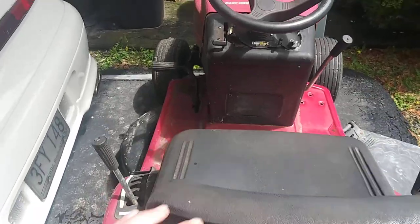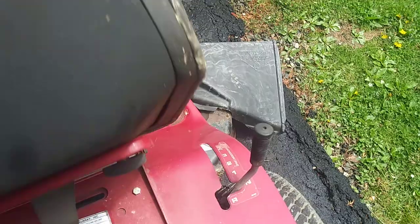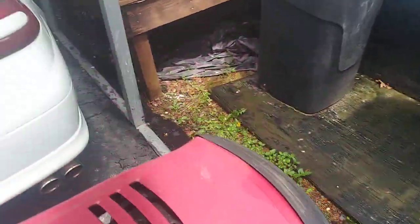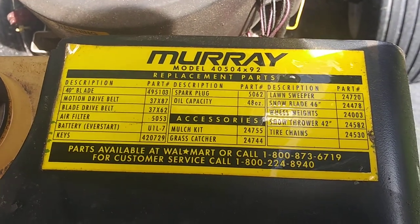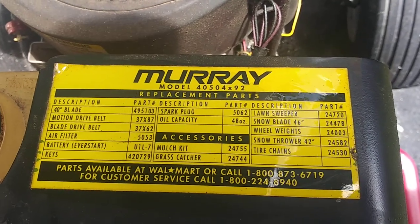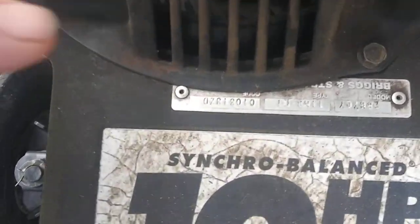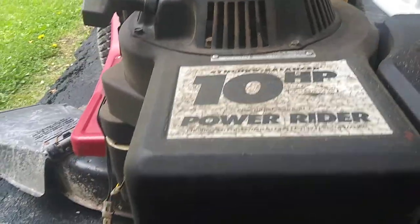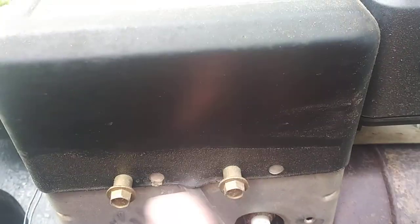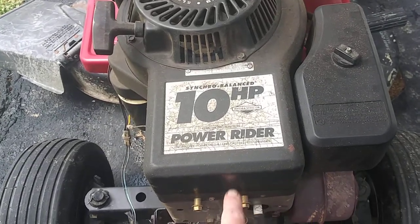The Racing Murray — model number for it is a service tag right here under the seat. And they're also kind enough to put one under the hood too. If you look right here, there's a whole bunch of parts numbers and model numbers — very handy. It's kind of nice how well Walmart did on a cheapo lawnmower, makes it simple. This one's about the same series — it's got the plate with your model, type, and code. On an older one, your code, model number, and all that info will be stamped in back here on the blower cover.